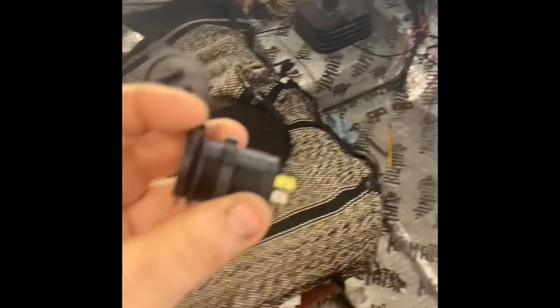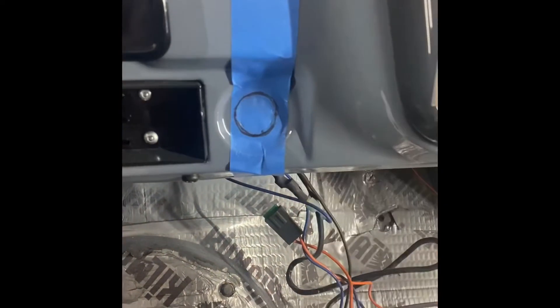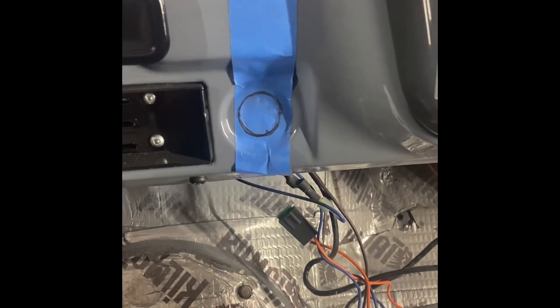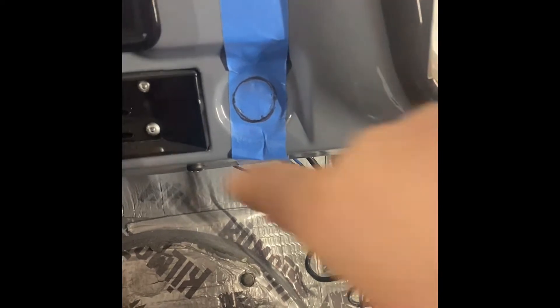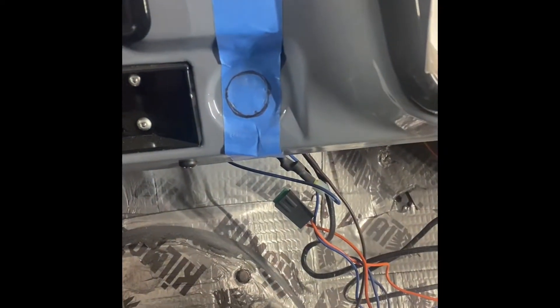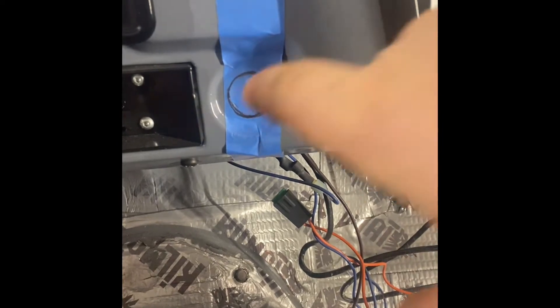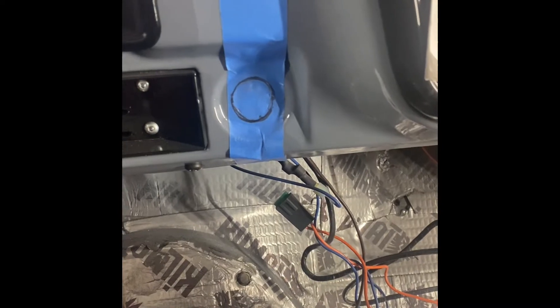It screws in through a hole. The truck had the cigarette lighter, so I masked it off since I've already painted the dashboard. I've got to route this out a little bit to make the hole bigger. I put some tape over it to protect the paint and I'm going to mask off the sides too to help protect from sparks and metal flying. Then I'll take a rotary file and open that hole up big enough for the USB port to fit in.